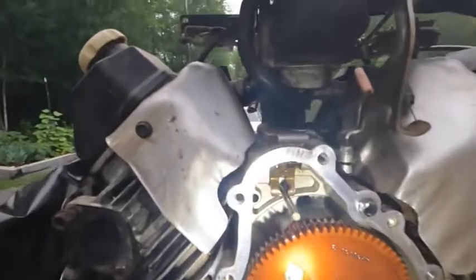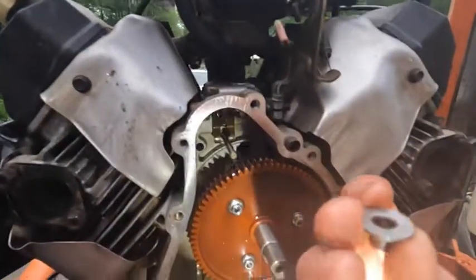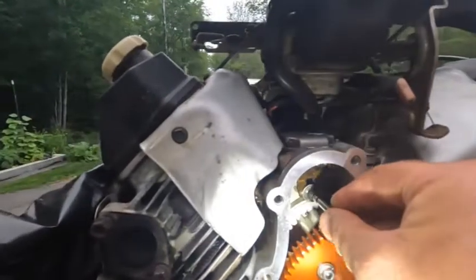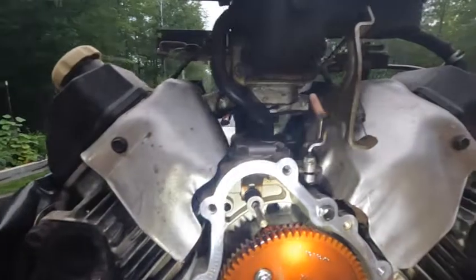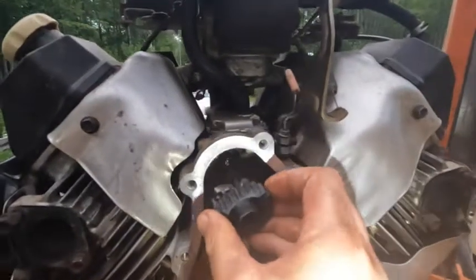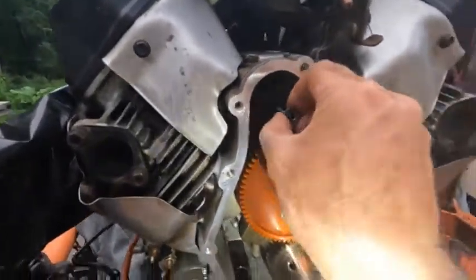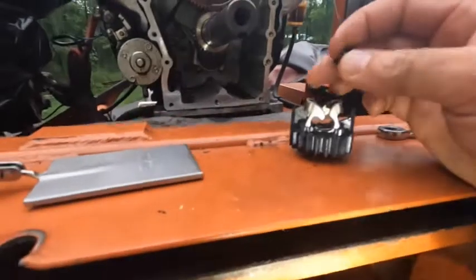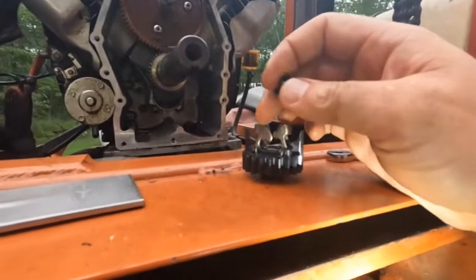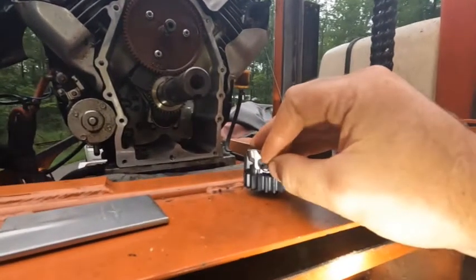This goes down here somewhere in this vicinity and that will get adjusted. Then you have these two spacers — one goes back against those fingers right there, one goes front, right in front of it, basically serving as a spacer. Push them all the way back — you see the detent on the shaft right there? This goes around that spacer right there. So let me show you what that will look like when the spacer is engaged. The weights fly out as the speed goes up, and as it slows down they close back in.